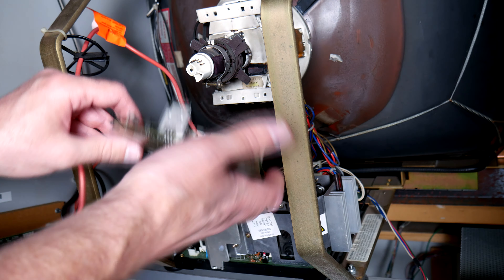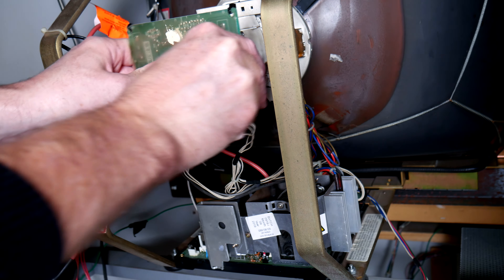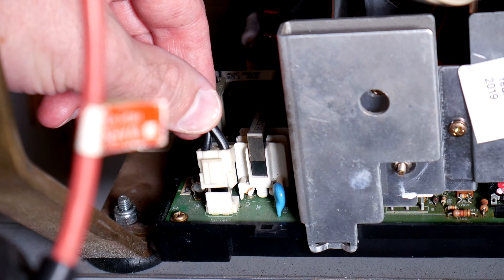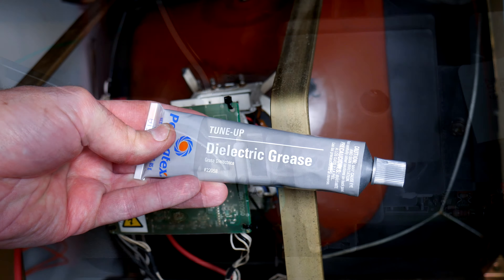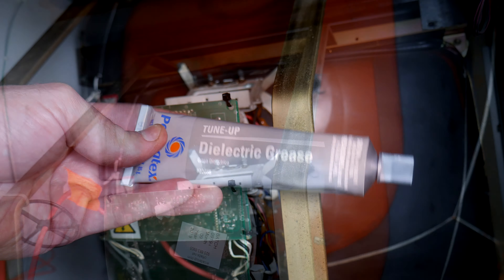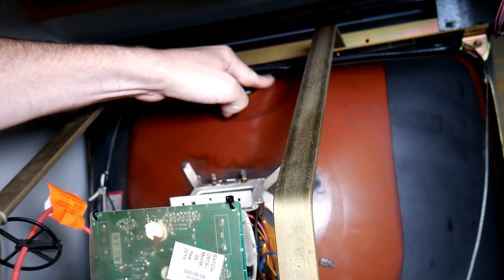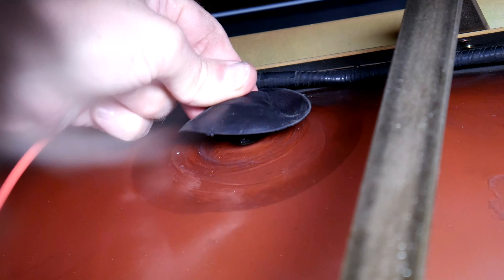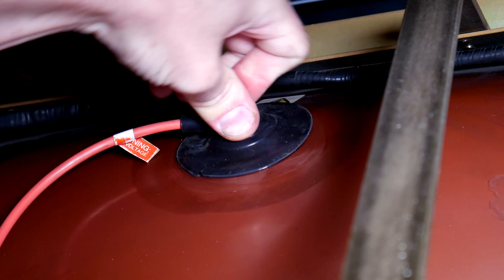That's actually what's going to connect back to our monitor tube — you can see those little prongs. Set those back inside. This is the neck board that's wrapped up. Looks like there's a new cap that's been applied to this. I do remember the bottom of this thing had some corrosion; I don't know if he was able to fix that, or would even fix that, but take a look here.